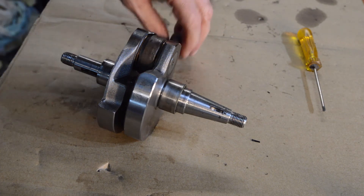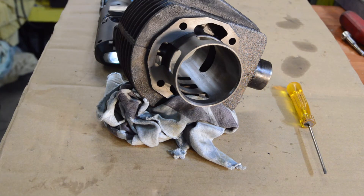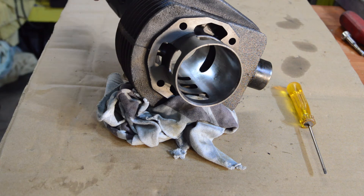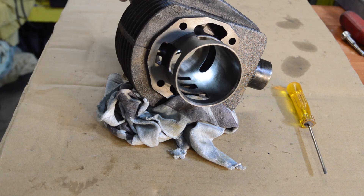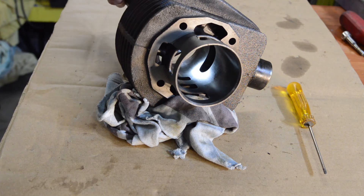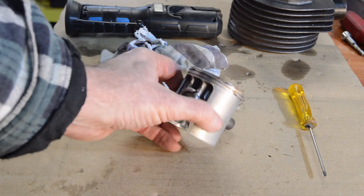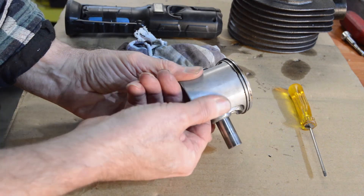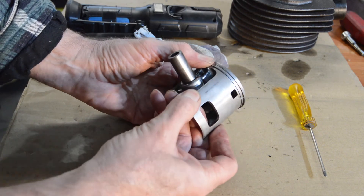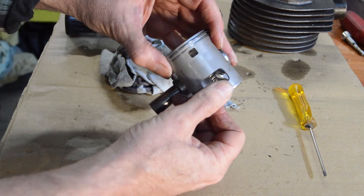So we've got good cases and we've got a good crank. Now it's hard to light a barrel, but there's a very, very tiny mark just in there. In the piston — again, there is the slightest mark down there, and a very slight one there. But you can't catch a nail on any of them — they're just discoloration rather than anything else.